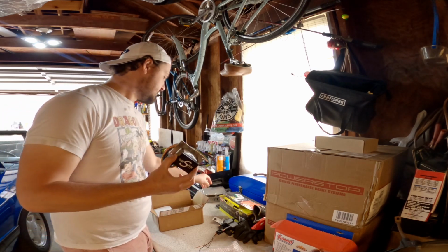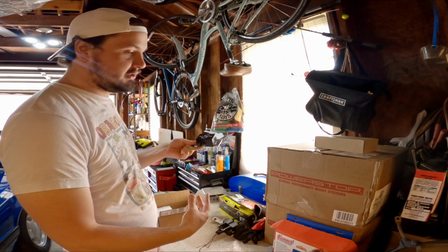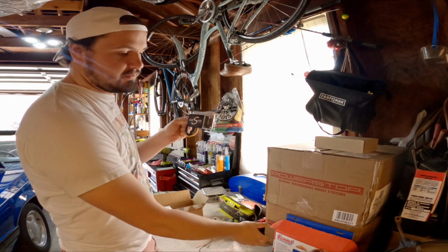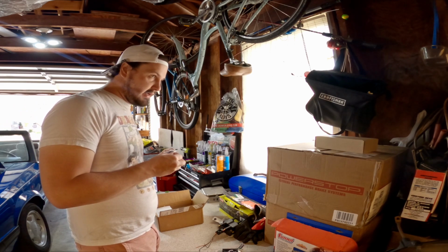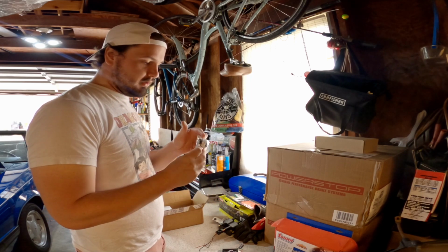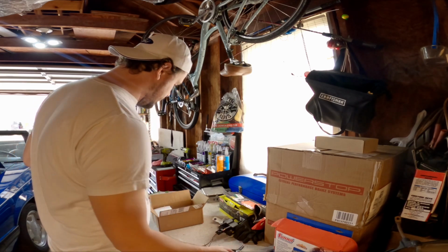So this is basically the same thing as Ford's factory ignition module, but it interprets the signal a little bit differently. Basically the MicroSquirt sends this the information, and this is what controls the coil, not something like the ignition box here. It was not something I really wanted to buy, but it seems like they had a proprietary type of connection on their coil, which is what I did get. So I ended up getting their connector, which comes with the pins and little boots and everything, so that's good. I get to have that.